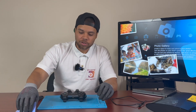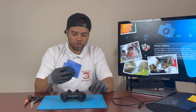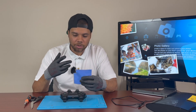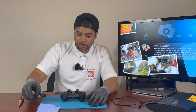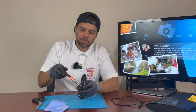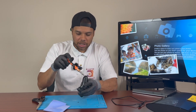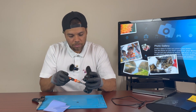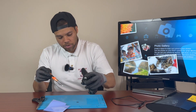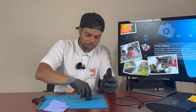The only things you really need to fix it: I use some thermal pad — a non-cut thermal pad that I use to replace thermal pads in PS3 fat models — but it works perfect for this as well. You can really use almost anything; you just need something to apply more pressure and thicken up that pad. I also use scissors to cut it and a Phillips screwdriver. These don't have any security or Torx screws, so I use the 2.5 size. It's a really cheap repair — you could even use paper if you wanted to.